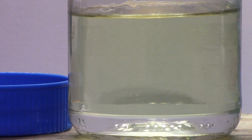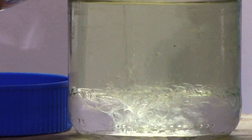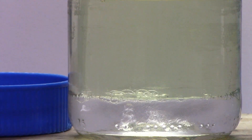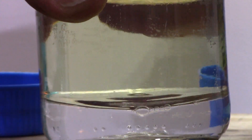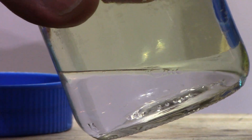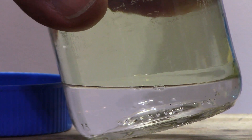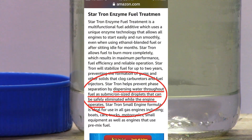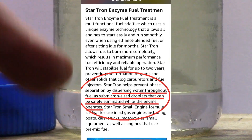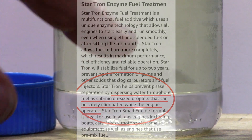In fact, let's go ahead and add a little more water so you can see that water always goes to the bottom. I suspect many of you have your own stories, and as the reviews show, most of them are positive and say this stuff is a miracle. I can't tell if it's dispersing enough water to matter or even at all, so I don't know how or if it really works. I worked as a mechanic many years ago and we always pushed STP and other additives because there was no way of knowing if they worked unless you took your engine apart. My little demo is like taking the gas tank apart to see what's going on. You could draw your own conclusions, but I don't see the water being dispersed into tiny molecules throughout the gas as they claim. And if they did, science tells me they're just going to drop back down to the bottom pretty rapidly, as I have shown.